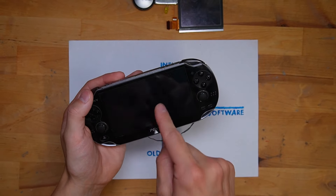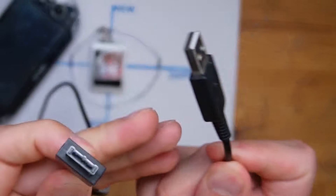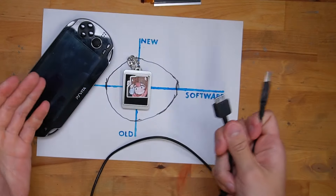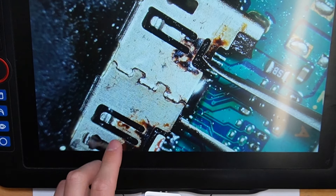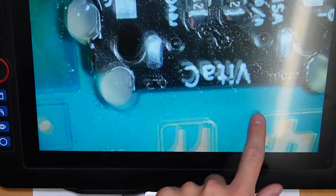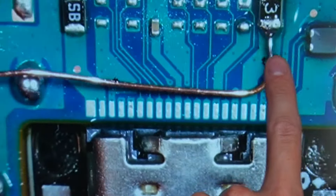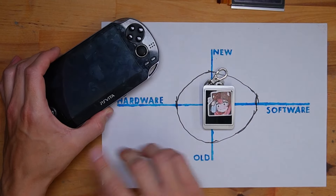Starting out, there were two things that really bothered me about the PS Vita. Number one was this stupid plug that you have to use for it, which as you can see is just a USB cable — this end is USB, but then in the format that only Sony can sell. One of the mods you can do on your PS Vita is replace this port with a USB-C port that's also on your mobile phone. However, this mod is pretty intense because you have to take off this thing, then clean it all up, put on another board on which you have to solder these things, run some wires — and these wires are tiny and you have to make sure that they align properly. These very intense hardware mods are way too far outside of my comfort zone, so I didn't do that.